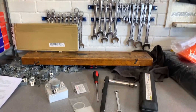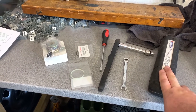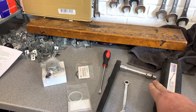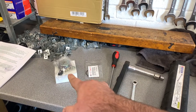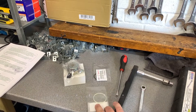Let's take a look at everything we're going to need today to do this job. Firstly, a torque wrench — we're going to need to torque these bolts on the solenoids to 6.4 Newton metres or 4.7 foot-pounds of torque, so get one within that operating range. We also need a ratchet with an extension and a 10mm socket, a 10mm spanner may also come in useful, and a flathead screwdriver. Here's the new solenoid, here's the new O-ring, and even though a lot of people reuse it, I've got a brand new backup ring.